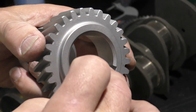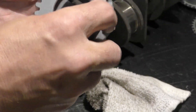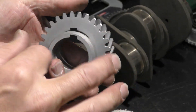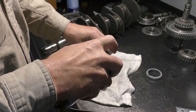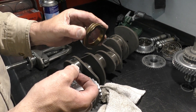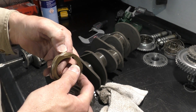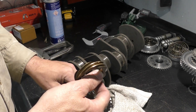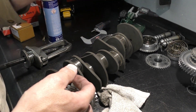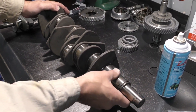This piece is just a spacer. The way this gear installs onto the crank, the chamfer side always goes against the web. So this installs like so, then our spacer goes on, followed by our distributor drive gear. I'm just going to give these a light oil so they don't corrode while we're working on our crankshaft. This piece here we've decided to go ahead and replace — I could take a small file and address that damage, but I don't want to run the risk of it creating a hiccup, because the only way to change this is to completely disassemble the engine. For a cheap part, it would be ridiculous to reuse it.